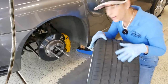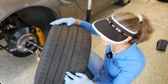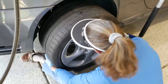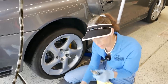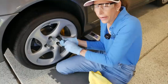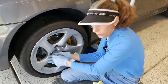Let's go ahead and refit this wheel back on — it's always an adventure. You do have these alignment posts which really help, and while the wheel isn't all that heavy it's just huge — it's a 295 wide tire. This is also a good opportunity to check your tire wear. These tires are pretty new for us and the wear bars are well below the surface, which is great, but this car has a nasty tendency to eat tires. Grab one of those posts, spin it around until you can get the other, and slide it on. For the wheel bolts I like to apply just the tiniest kiss of Neverseize so they don't get corroded — just a tiny bit on the end of the threads, not much more. That'll help keep the bolts from getting corrosion-welded in.